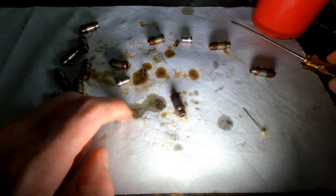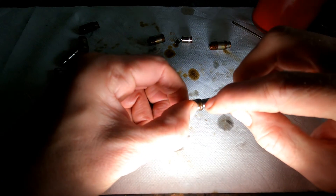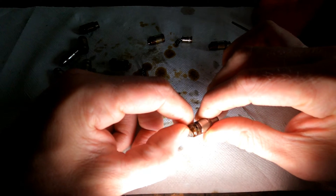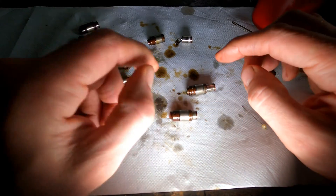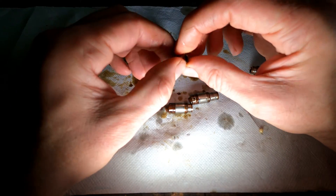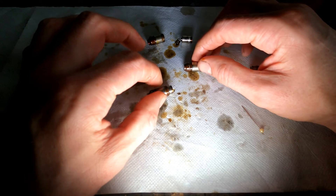So you need to clean it and get all the oil out of it. If you have it like this and you can push it in and it will stay like that, then you have a damaged hydraulic element and you should replace it. I damaged this one when I removed it, so this one cannot move freely like this one. So what I am now going to do: I dismantle them all. I leave the check valve in there — I never remove it because it is a very small spring and you can just test it, so it is not really needed. I just degrease it and that is it, because there is a possibility that you damage something and have to buy a new one. They cost like 15 euros a piece.